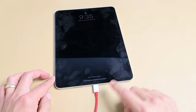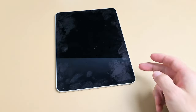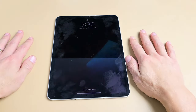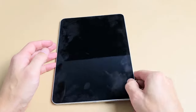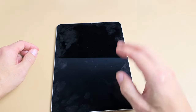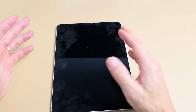You're still stuck in a boot loop. Next step is what I call the tap method. We're going to use two fingers — lay the iPad on your desk, use two fingers, and tap all over the screen and all over the back. The premise is that you may have something slightly dislodged, and a single tap can pop it in place, and all of a sudden you'll be out of the boot loop.